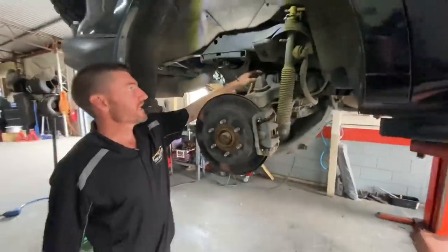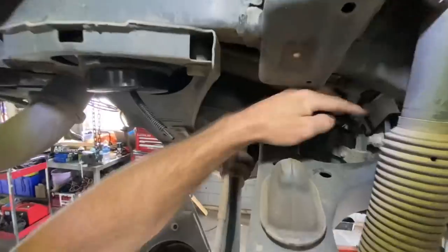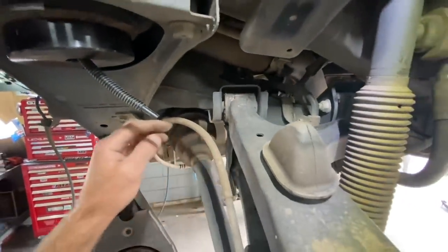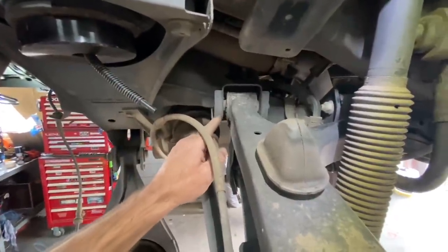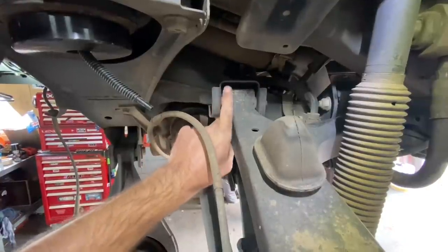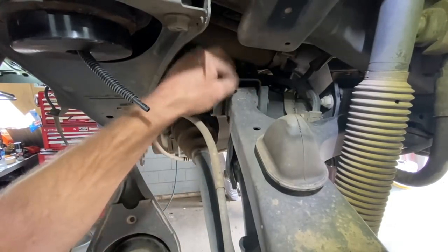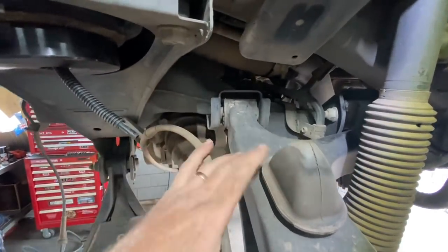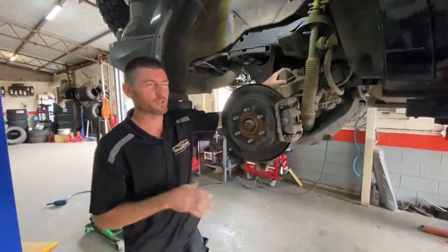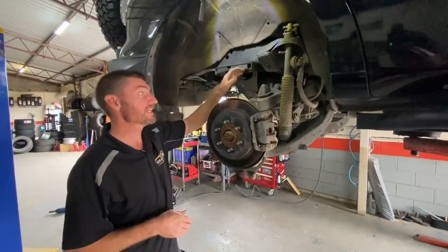The bushes at the back take the place of the genuine bush in this section, both front and rear of that upper arm. When you get these off, don't think you can just jam the new bush back in - there are a couple of little lugs, two little nipples that need to be shaved down flat on the surface where the new bush goes in. Make sure you get those done. Getting the arm out is a bit of a process, but the bush itself is self-explanatory with instructions in the box.